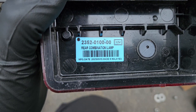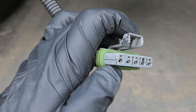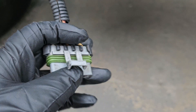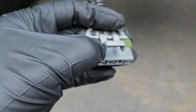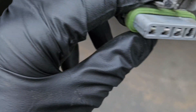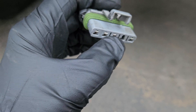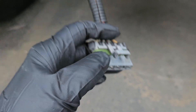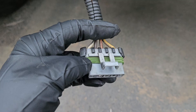By the way, this is the part number in case you need to grab it from a dealership. When you get it back on, make sure this is kind of tight. Sometimes they will not slide in perfectly, or if they're corroded or cut up, they can bunch up. You want this all the way in evenly on each side — that prevents water from getting in. But if you had corrosion previously, that means it's likely shot, so you want to get a new pigtail, which will come with this. And there we've got it in as good as it'll go — even on each side, and none of that is sticking out.